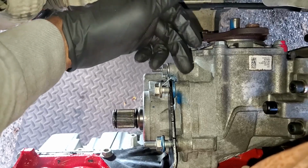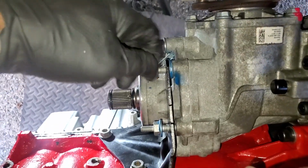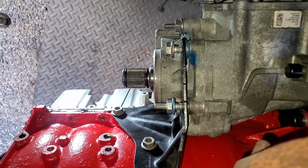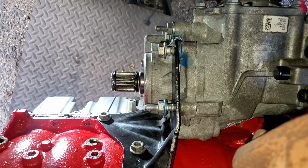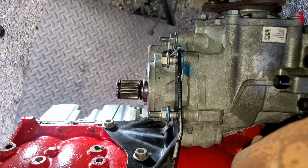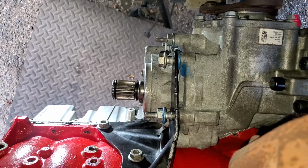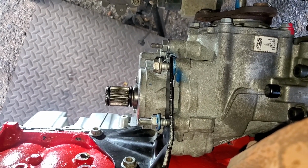This bolt goes here, and I'll use 3 shimmed washers all the way around because the distance is very consistent with here. The spacing is consistent all the way around, and I'll just put 3 grade 12.9 bolts in here, and we'll have a nice bracket that's secured against the transmission, no play, and it'll be even better fixed than the modified brackets that some of the other people may possibly sell. It'll be stronger and fixed in position. So we have a nice solution, and it works.